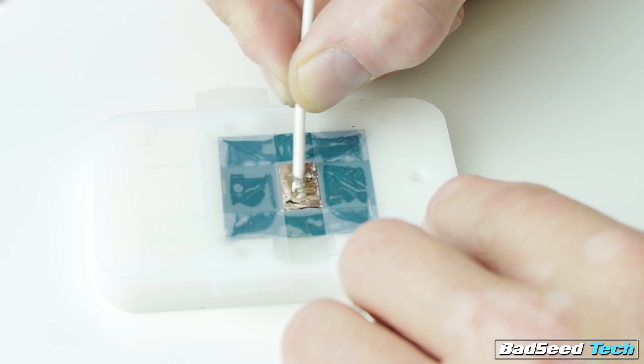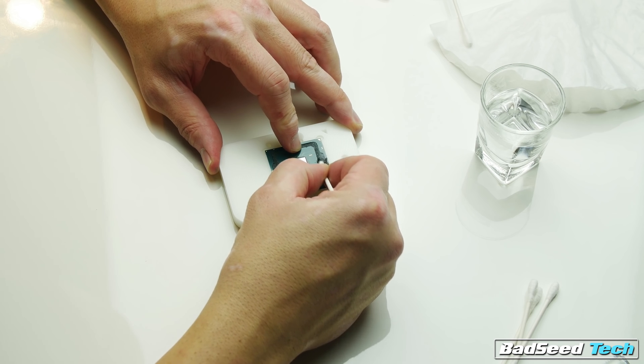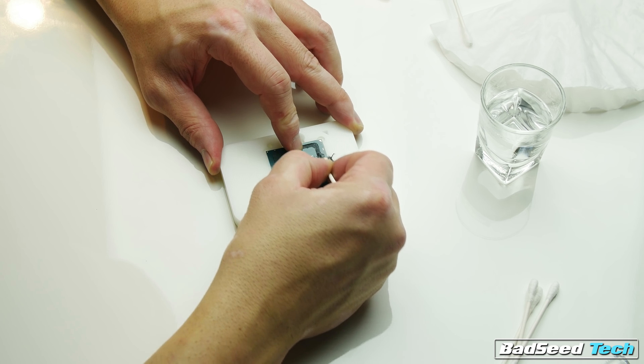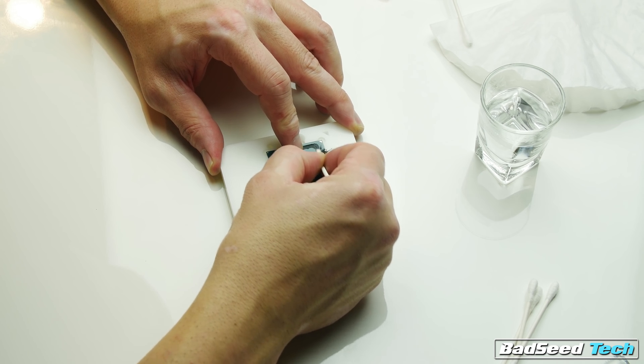The only real sticking point for me was working with the liquid metal itself. I used Cool Laboratories Liquid Pro — it's just a really weird compound to work with if you never have before. Being a constant offender of putting way too much thermal paste on a CPU, I had to make sure I was very reserved in my application of liquid metal here. I was very careful to make sure I got rid of all traces of any pre-existing sealant, both on the heat spreader itself and on the die, because I'd read that this can lead to the heat spreader not sitting 100% level, which obviously affects temperatures. I was pretty ginger when cranking down the set screw as well — I didn't know how much pressure that lid could take, so I just cranked it down to just a little bit more than finger tight.